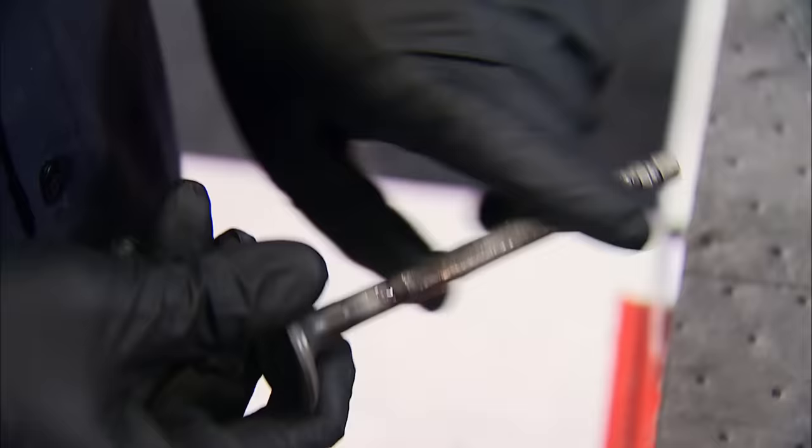For this next step you can use a heat gun or an oven. The goal is to warm the part up so it's warm to the touch. This will make the Wrinkle Plus stick really well to the primer and lessen the chance of a run. Once you have two to three good coats on, continue to heat the part and watch — this is real-time, not time-lapse. After letting it sit for a couple of hours, add the color to get it back to its roots: Ford Blue.